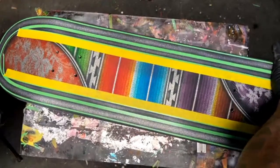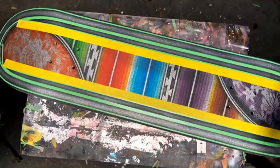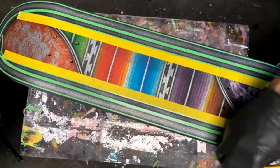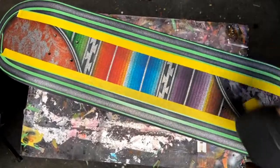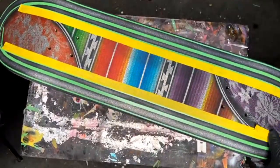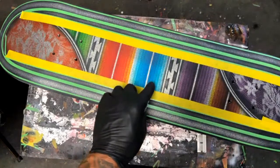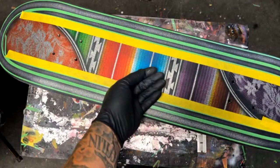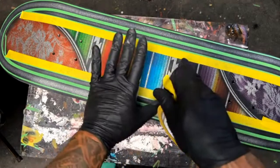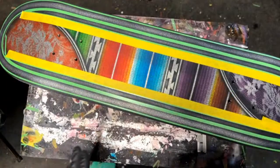Maybe not. Well, if you were to hit it really wet at first, say I'm just getting ready to clear this, and I'm going to put a really fat, thick coat on it. Those solvents are going to be really wet on there, and it's going to stay really wet for a long time. If it stays really wet for a long time, it's giving these layers of candy time to leach up into the clear coat and then shift around, because clear coat shifts around and flows out. So it sucks it up and it flows it out. That makes sense? Because it's so wet at first.